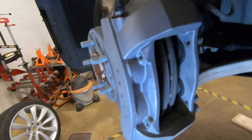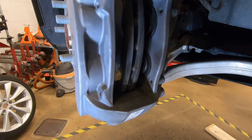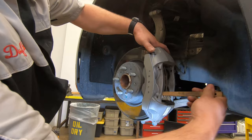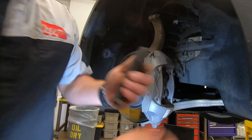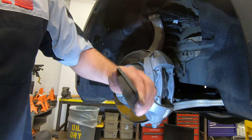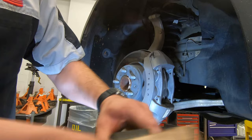Next, get inside and remove any corrosion between the caliper and the rotor using a small wire brush — go in between and clean out where the brake pads touch. Then spray down the inside with brake cleaner to get the residual residue out. For the brake pads, clean up the edges. This one doesn't have very heavy corrosion so just use the wire brush to clean off any residue. If there are big deposits of rust, use a wire wheel on a pneumatic tool, but honestly these look pretty good.